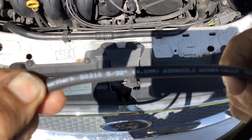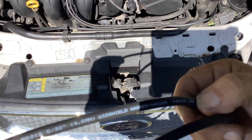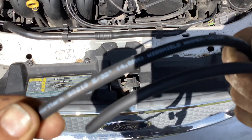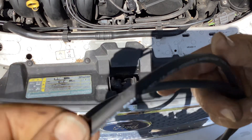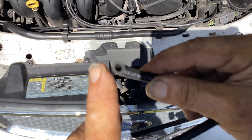It's vacuum hose slash windshield washer tubing. It's also 4.0 millimeter if you want the metric conversion. 5/32 inches would be the inside diameter of the hose you need.